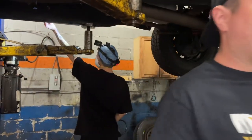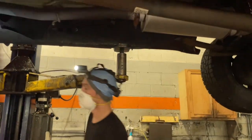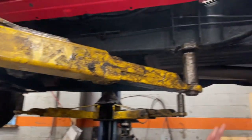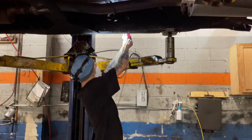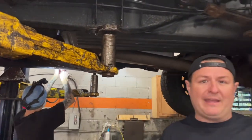Another thing with our re-coats — we have them structured. If you do them on time about every year, we also include a hard-to-get area. So one year you'll come in and we'll pull all the panels. The next year we'll pull the liners again. The year after that we'll pull the tail lights. The year after that we'll do the doors and the hood. So it's a constant rotation of those hard-to-get areas, but you're always getting your bulk spray. That's how the oil-based coating works — you have to keep reapplying it to keep the water separated and also to address any wash-off areas.